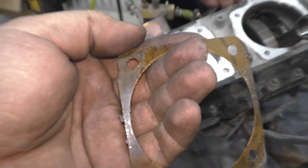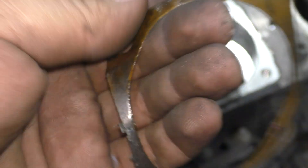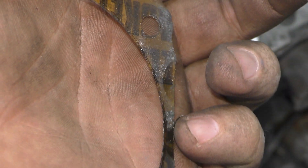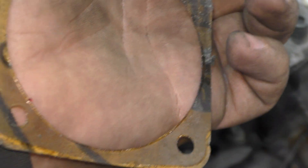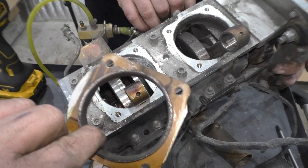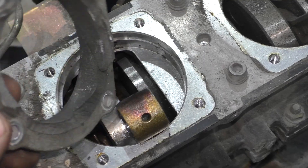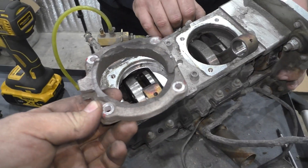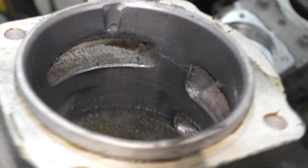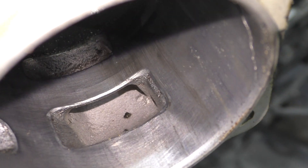The cylinders are installed on gaskets to the engine crankcase using a very old technology. The gasket is cut from paper coated with solid oil and assembled. When heated, excess solid oil is squeezed out and the gasket becomes more airtight. In a classic two-stroke engine, the intake window goes into the scavenging chamber at the crankshaft. Here, the intake window goes directly into the cylinder and scavenging chamber.